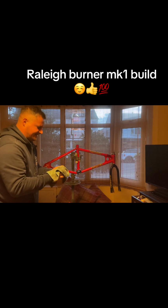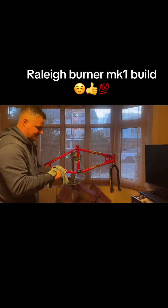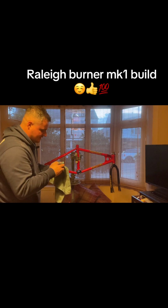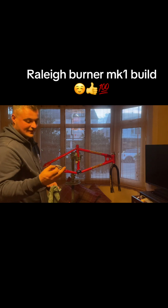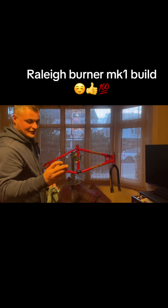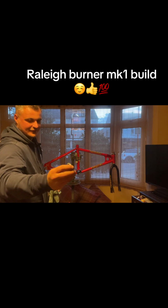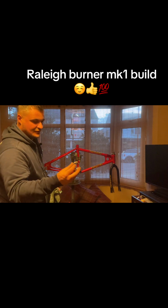Nice and clean. Fresh. So they've obviously been put in grease, prepared so they stay in good condition. They're nice and clean now. Like I say, there's two ways of putting these in, and you can do them wrong. If you look on there, you don't want this outer ring on the inside. All you're doing is running these bearings around, and then it'll wear out quicker.